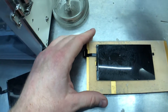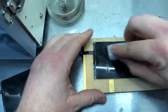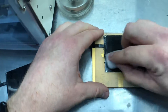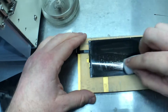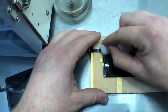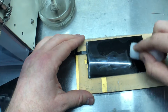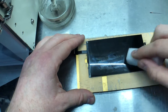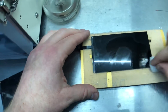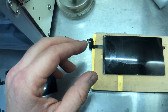The liquid I'm going to use is just acetone — it's readily available worldwide — and a magic sponge. It's good to be careful at this point and not use too much liquid. I started in the middle and then I'm working my way to the outside. If you start on the outsides or you get too much liquid on the edges, the liquid will run into the backlight and then you'll need to replace the backlight afterwards. It's not the end of the world, but it is avoidable.